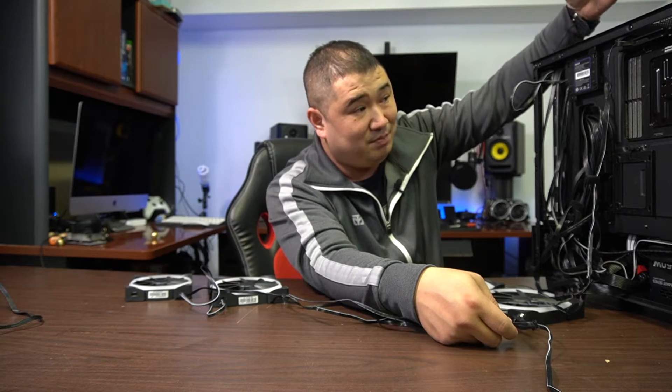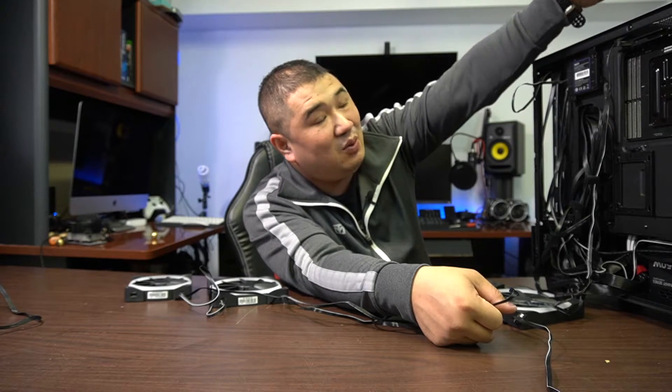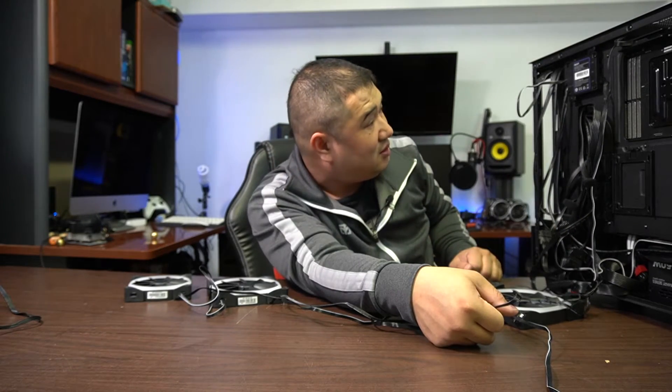This comes off the actual AIO pump. When the pump runs on the CPU, the fans will just keep going. The other question is where do the wires for the AIO go? One has a USB — a fat USB — that goes into the USB header on the motherboard. You also have another wire that comes out: it's your power wire, and it hooks up into a SATA power connector.